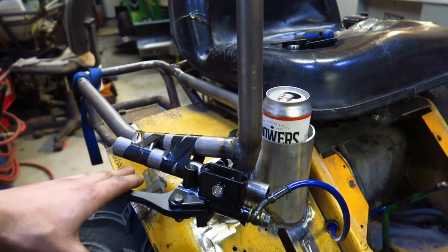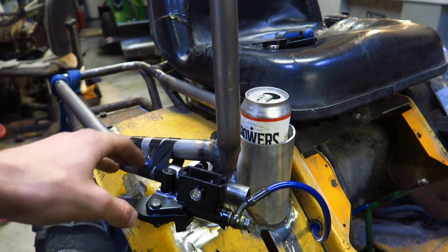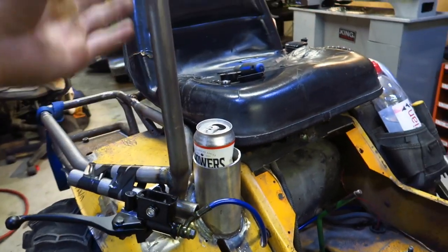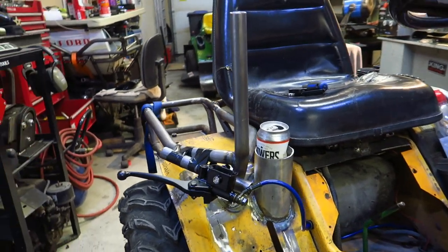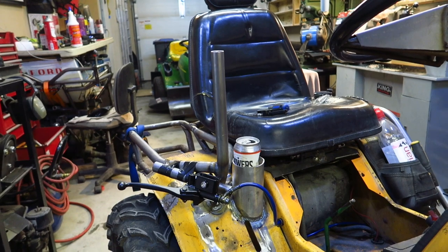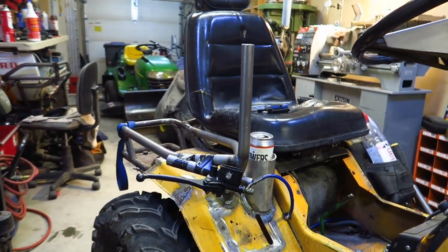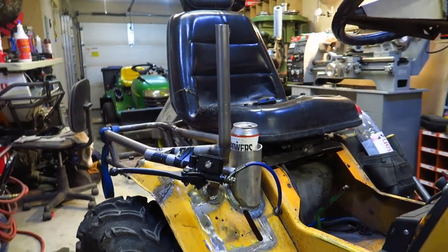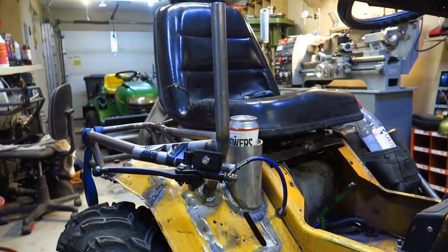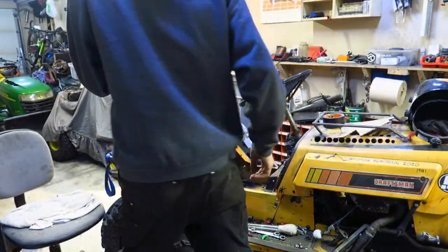Anyways, so tape it onto something, grab another piece of tube, clamp it onto that so that you can just sit here going like this instead of upright and at stupid angles. But once you do fill it up with brake fluid, you can put it at any angle you want as long as it's sealed. So it's a great system once you get it in the good state. But anyways, let's fill this up and start putting some pressure in the lines and bleeding it. Let's do it.